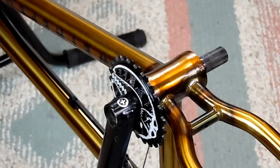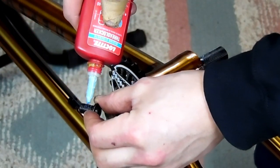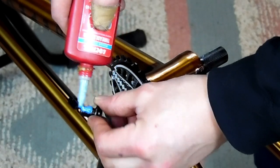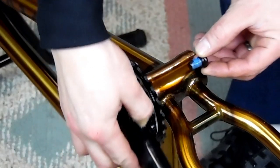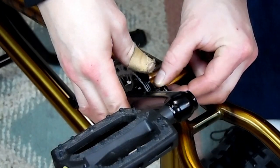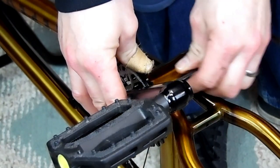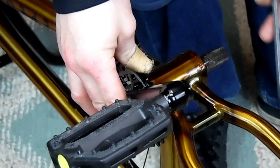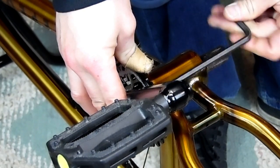But after you do get it tight, I put my sprocket bolt in. Now if you take your sprocket bolt in and out a lot and it wears that thread lock off of it, I put a little bit of Loctite on there — I use the blue stuff, never the red. The red is the stronger of the thread locks.